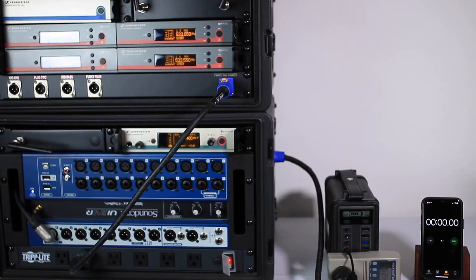We have everything set up here. An interesting note: the Energizer will actually technically work as a UPS as well — I have it connected to power right now and everything is fired up. I'm going to pull the plug, start the clock, and the goal is around three hours and 30 minutes. As you can see, we're pulling about 53 watts consistently. I don't have a speaker hooked up — normally I use my Maui 5, which allows for a more consistent draw. In general I only need 45 minutes to maybe an hour and a half, but having the extra capacity is definitely peace of mind in such a light package.